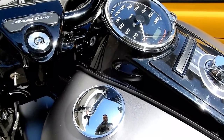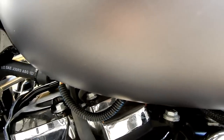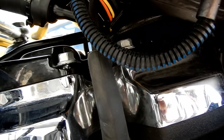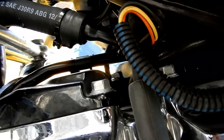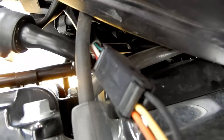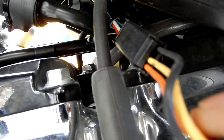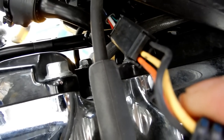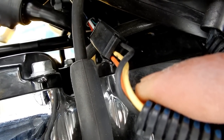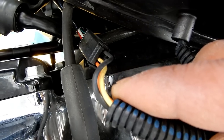The fuel gauge is connected with a wire that goes down underneath the gas tank, close to the engine. It's connected with a plug that you can see right here. We're gonna have to unplug this and then disconnect the cables — probably take the pins out of the housing so it can pass through the gas tank and we can get it off the bike.